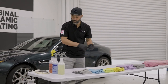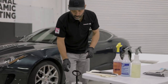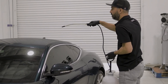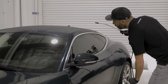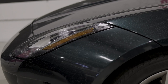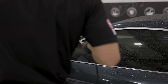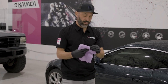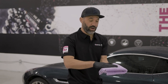The first thing we're going to do is wash the body. We use a no-rinse eco-friendly washing system here where we soak the panel, and we always work from the top down. You can see this car came in pretty dirty by California standards, and it has water spots on it too. This is our washing towel — I like to check it to make sure there's no debris from running it through the washing machine. It's really, really clean, and we use it folded into a square, always with the high pile out.